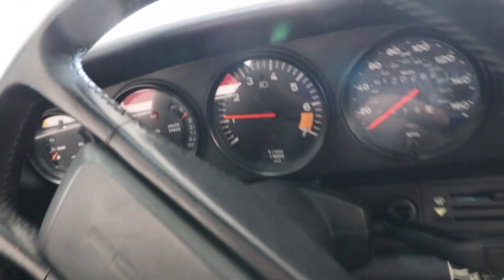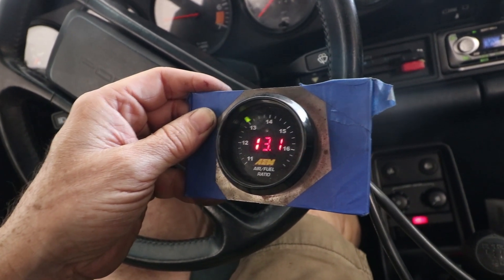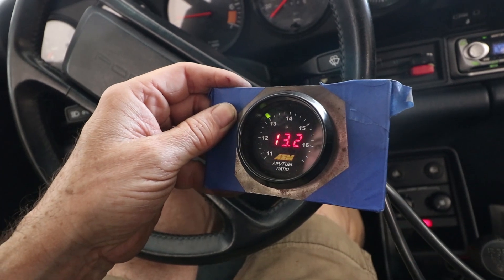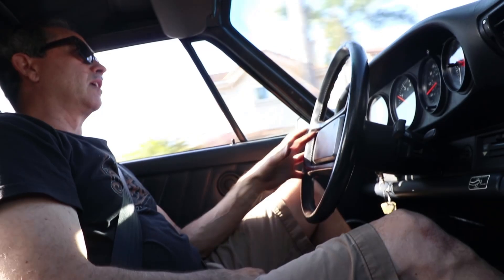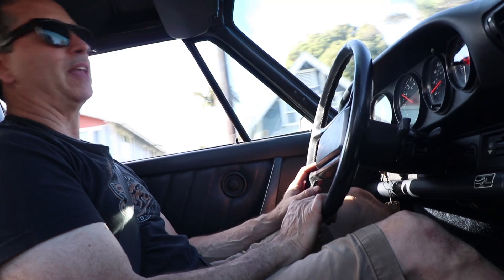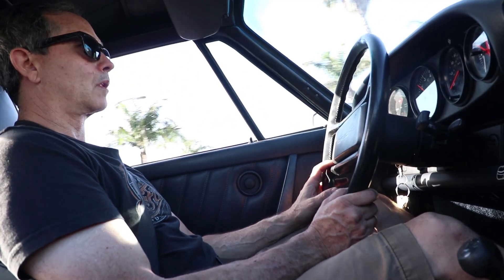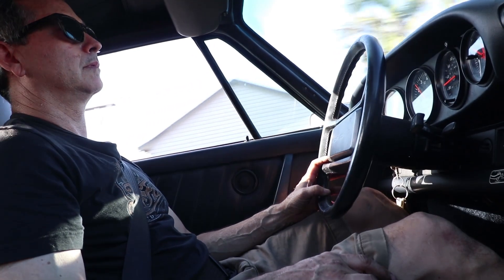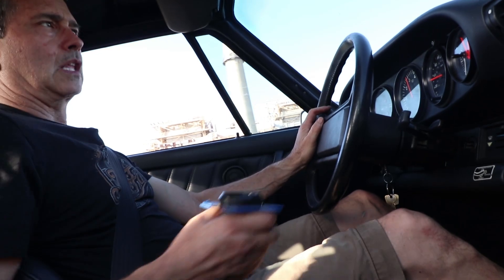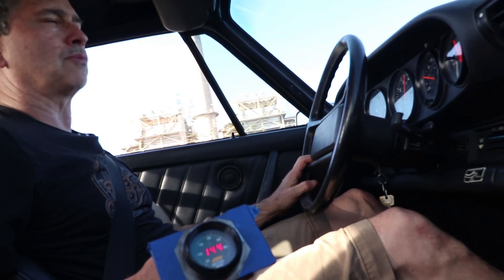The engine's still warming up and it's in the 13s — that's perfect for cold start. Once the engine warms up the idle will come down to about 800. I'm not even a half mile from my house already and I can already see that it is running smoother. Part-throttle cruising it's right in closed-loop mode at 14.7, 14.5 — right there.